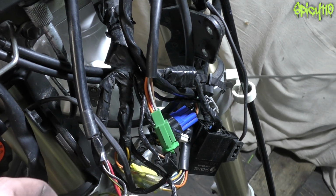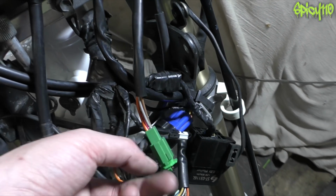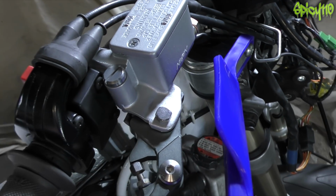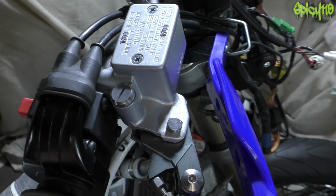I've made sure that's routed in the right direction with the throttle cables in mind. This lot lifts up out of the way when the light gets here. So I had to undo the clutch cable and switch round that handguard. Of course, that meant I had to switch around this handguard. Then I checked the throttle and realised that the throttle open was okay, but the return was misadjusted.